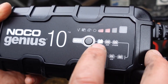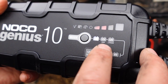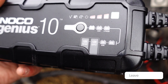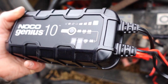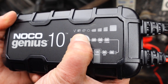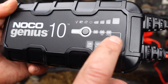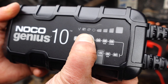For the type of battery — regular conventional batteries, you just want regular 12 volt. AGMs, gel cells, and lithium are separate settings. You can hold the button down for three seconds and it cycles through: 6 volt, 6 volt AGM, and so on. It backed out because it knows it's not 6 volt.